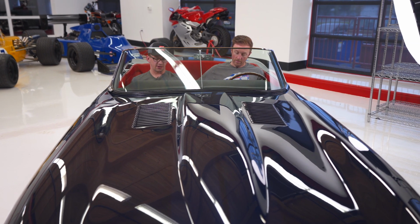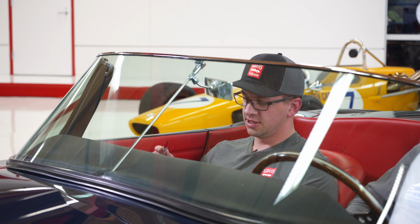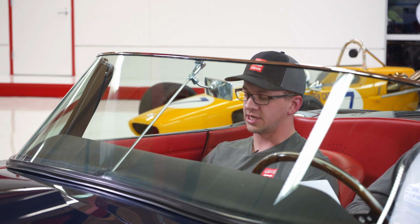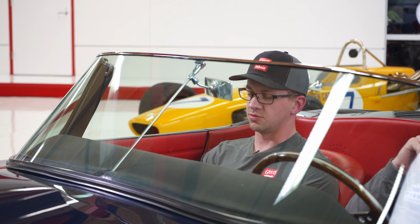That's a good one. Alicia Leonard asks, how soon can you wash your car, expose it to rain after applying finishing sealant? Alicia, you always ask good questions. This question is specific to finishing sealant, but this answer is going to apply to pretty much all of our protectants. It's ideal to allow 12 to 24 hours after applying a protectant before it's exposed to moisture.